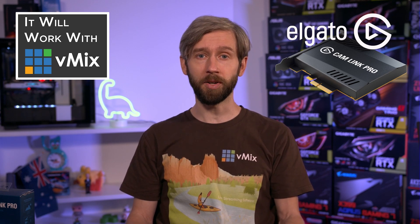The Elgato Cam Link Pro cards are kind of crazy. They'll allow you to have four full HD or 4K HDMI cameras in your production for around $360 US dollars, which is pretty much unheard of. We could easily be using this card for our productions with no problems — we don't use more than four cameras, we use 1080p 60 for these tutorials and for our live stream, and the card works really well in our testing. So if you're looking for a capture card and want room to expand, a four-input card is a good option.